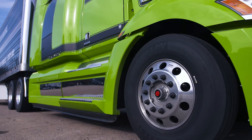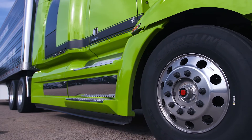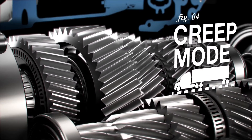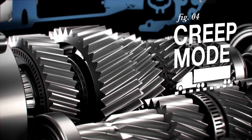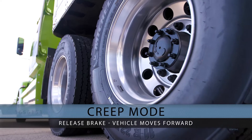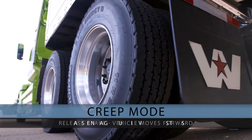The vehicle's urge to move can then be felt. Following this and for the duration of the current driving cycle, creep mode is active. Once the vehicle is stopped via the service brake, the vehicle will begin to creep again without any accelerator pedal input.